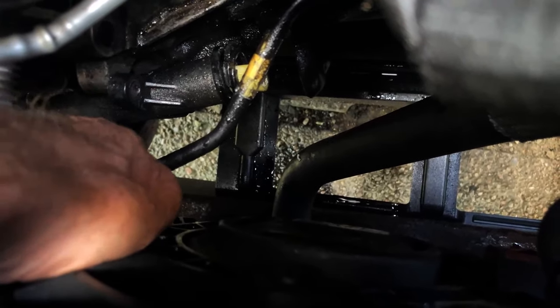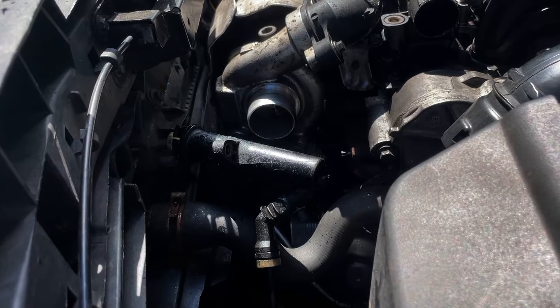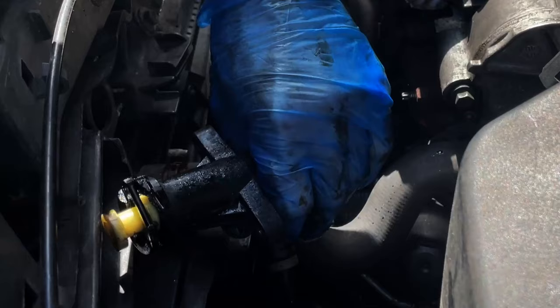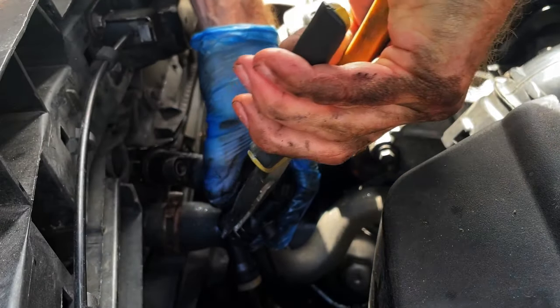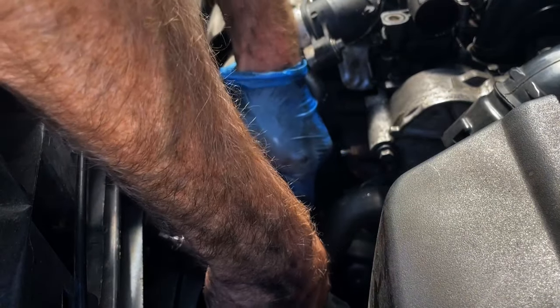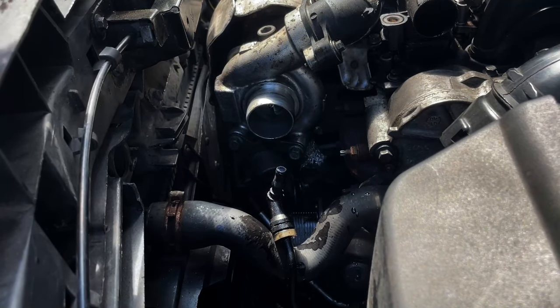You've got your hydraulic pipe that has two clips on it — clip out and then pull the hydraulic out. The pins are on the underside, two pins pop out and then it'll just pull out. There's only one because one of them has fallen out, but they're an 8mm Allen key — looks like a 10mm thread. Now if we twist it there we go, two clips there. I'll do the difficult one first. Let's get it out — watch out for leakages — and there we go, a bit of leakage there. Let's clean that up.